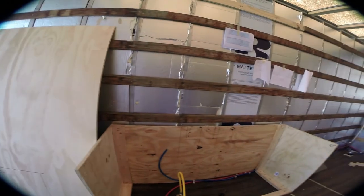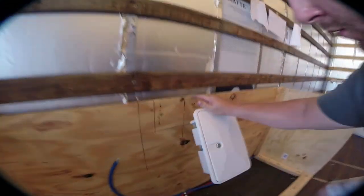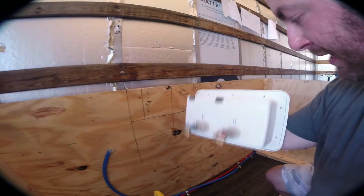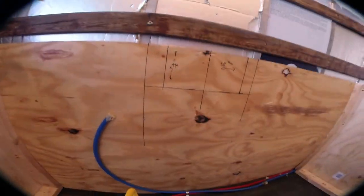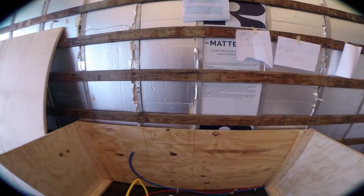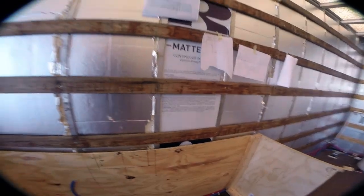The next step is to mount the outdoor utility shower on the outside. It's gonna mount right here — the cutout size you need is five and three-quarter by ten and three-quarter inches. It's held on by sheet screws and some silicone. I'm going to use a drill to transfer the cutting template to the outside, so I'll have four drill holes marking where I need to make cuts. Then we'll cut it out with an angle grinder, it'll slip in, and the countertop will slip on top and close everything off.